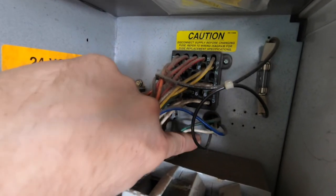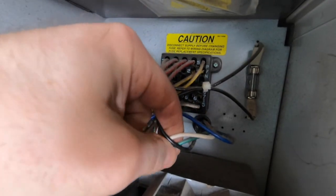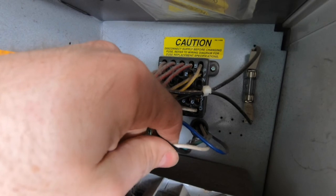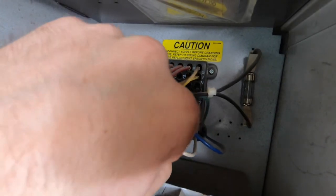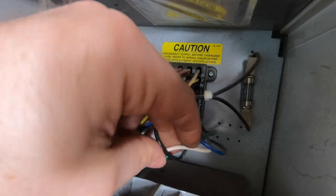There will be a few wires — blue, black, white, and green — coming through from the back of the machine. The black and white wires will be the 120 volt source of power to be used to splice with a PayRange high voltage power adapter.